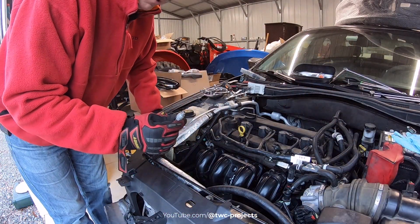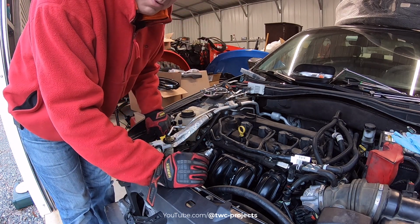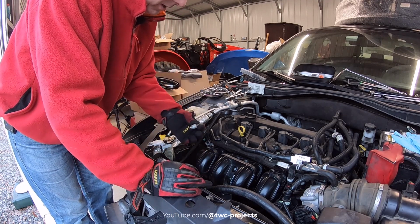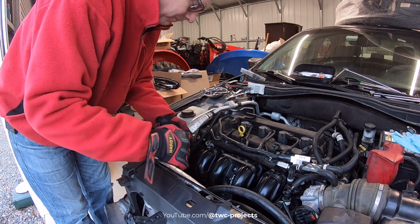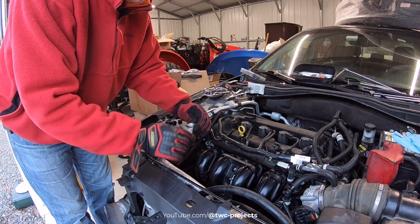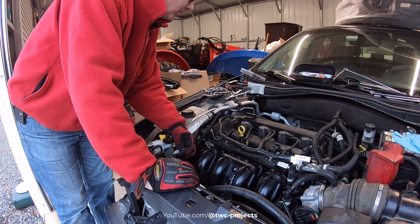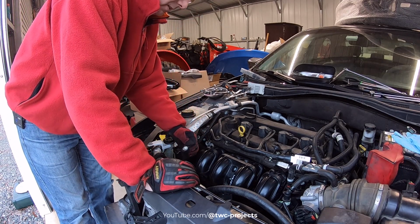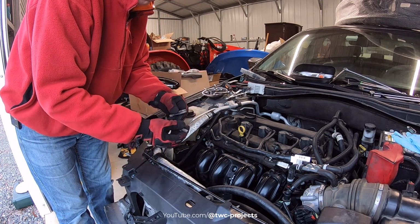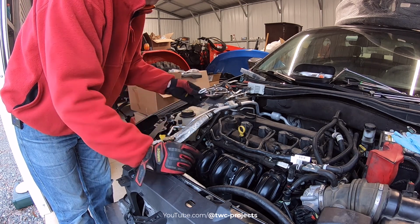So one other thing I wanted to mention, what I didn't record was the last 2 hours or whatever I spent fussing with trying to get these, the radiator, this is from the old one, but trying to get these connected on to the radiator. Because the pieces had been bent, just getting the threads lined up, I ended up cross-threading one of them, which I did not want to do, and so I had to go out and buy a tap that would fit this, which is basically a 3/8 18 thread.